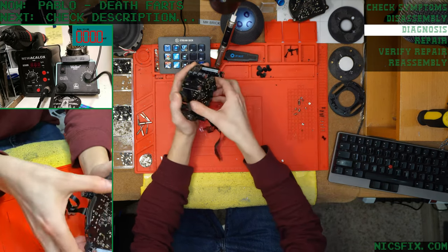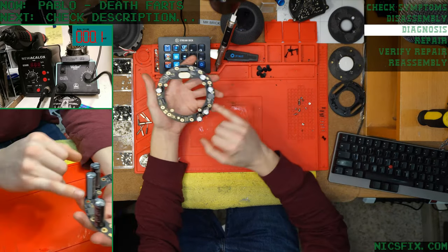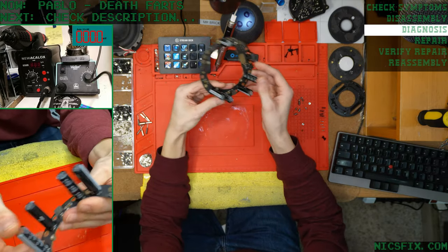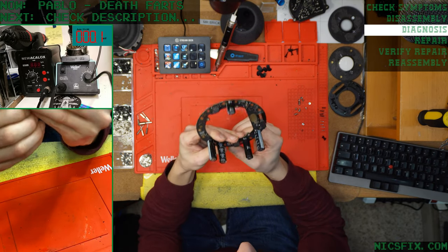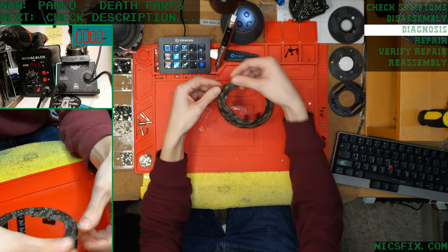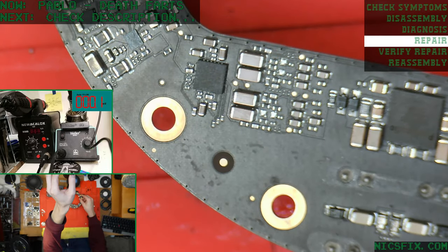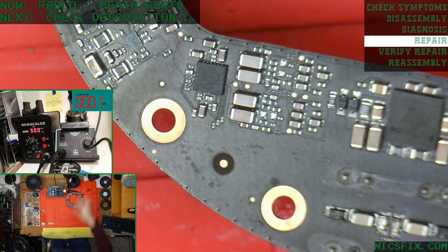And then, as with every HomePod that comes apart on our bench here, we're going to replace the Schottky barrier diode on the amplifier. That's the part that loves to fail eventually and cause no power. Granted, only certain date codes of these diodes are failing. This one has 1752K, so it's a little newer than what we see typically fail, but we're going to replace it regardless. First things first, though, let's get up close, get a little focused, and pull off our bad filters.